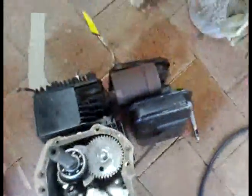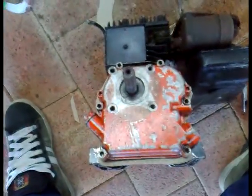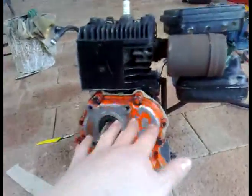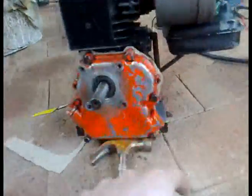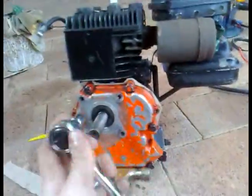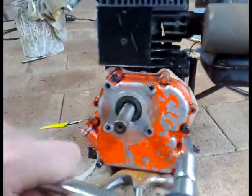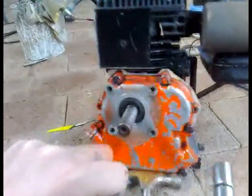The gasket's all on now. I'll whack the cover on — I'm going to have to go off camera to do this but I'll show you in a sec how to torque down the bolts. You'd usually torque them up with the engine flat on the ground which is usually easier, but because I have fuel in my tank I've got to do it like this. Basically you start from the middle and then work your way out in a crisscross motion.